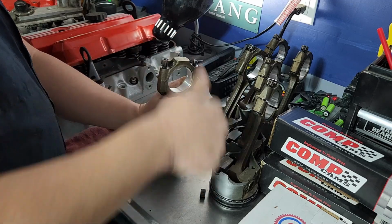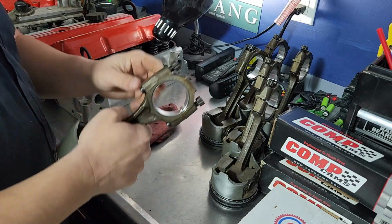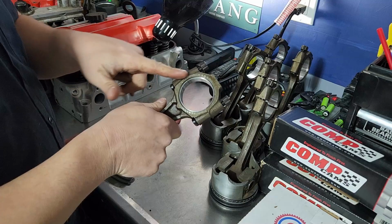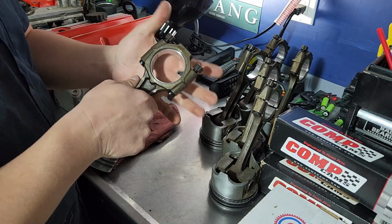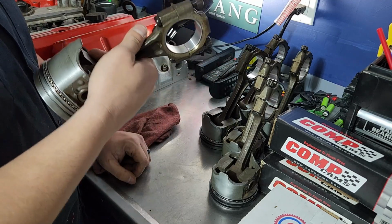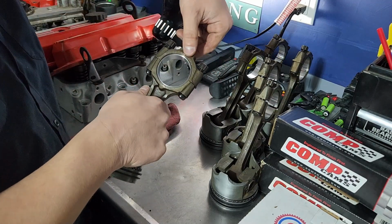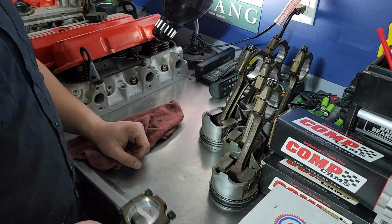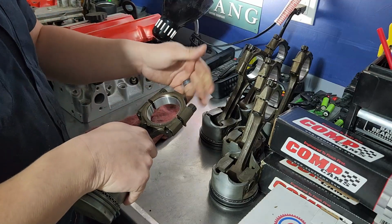All right, so all of these are in. Now you might have seen me when I was taking these and just kind of smacking them on the table here, for concussive effect, because obviously the way these are together, it's very rigid. Everything should be perfectly straight. You shouldn't have any problems. Should slide right on and off perfect. That's not necessarily exactly how the world works, and there might be just a little bit. And hell, even if you go put these things on, if you're not laser machine straight, you'll put them in a bind. So sometimes just a little smack on the table, something like that, to just kind of concussively shake them loose is all you need to do.